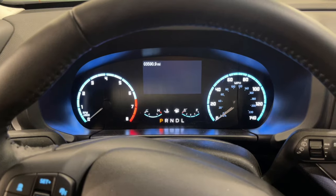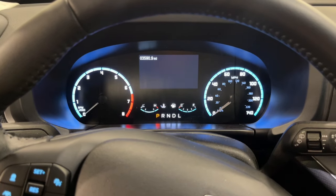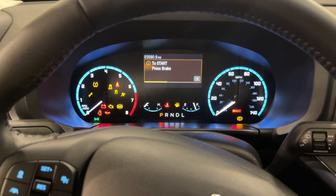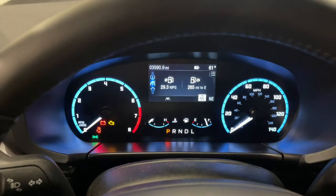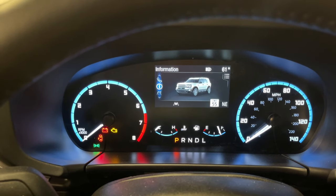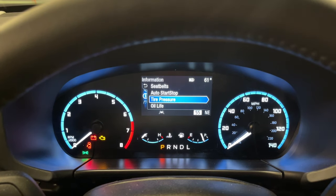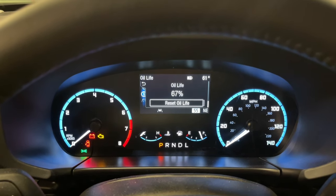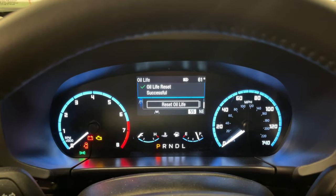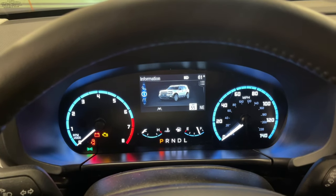Inside the vehicle, I'm going to step on the brake and hit the start button. We'll start it up and let it run for just a couple seconds, then shut it off — now we'll be able to get a good level check in a few seconds. In the meantime, without stepping on the brake, I'm going to hit the ignition button. We're going to use these buttons here and scroll up to information — hit OK once. We'll click the menu button, then scroll down to oil life and click OK. It shows 60% remaining — they wanted to do a pretty short oil change interval since it's brand new. I'm going to hold down the OK button to reset the oil life. Successfully reset — 100%. We can hit the back arrow to exit and shut off the ignition.